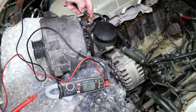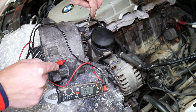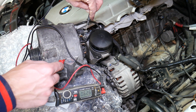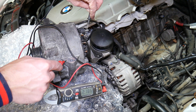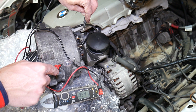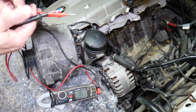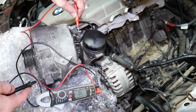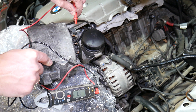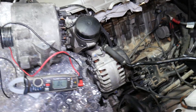The 12-volt terminal on this alternator is on the back side — that's where you attach the wire that charges your battery. I'm going to touch the black lead to it and the red lead to the casing of the alternator. Find a clean spot; if it's not working, scratch it a little bit. Under the bolt is usually a clean spot — that's where I test it. We get 541. Any reading between 500 and 800 is great. Then switch the leads — red on the charging wire, black on the ground — and you should get absolutely zero, no reading at all. This one is good.